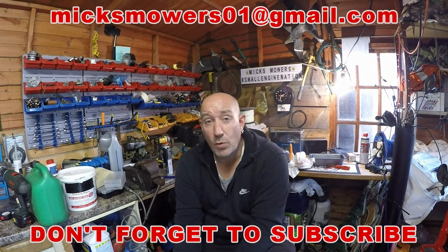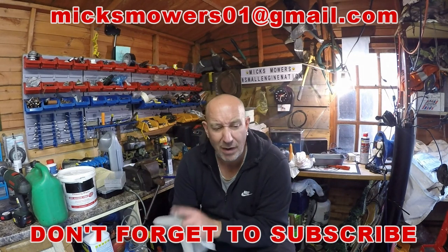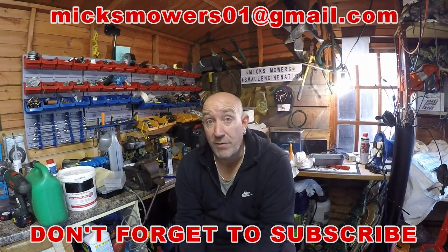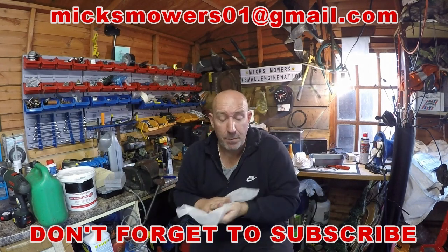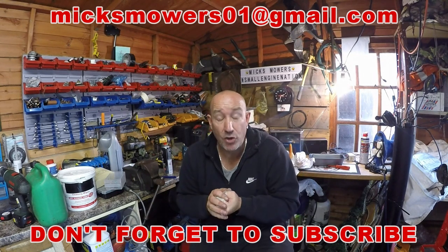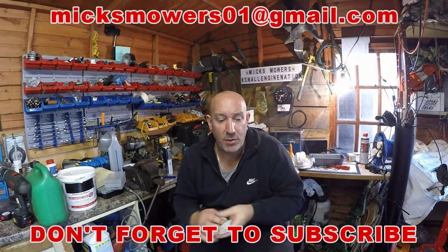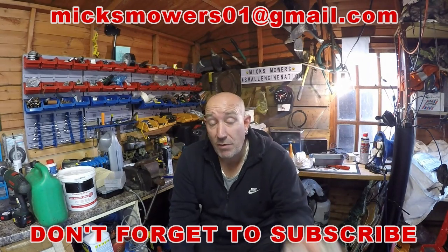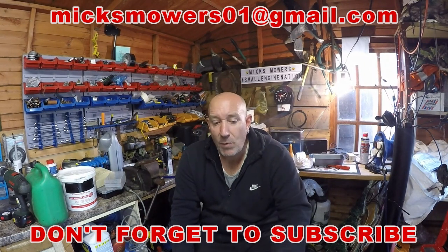So next I've got to do a Power Force Strimmer, or I've got a Homelite Mighty chainsaw. The chainsaw I think I have actually had running already, but I think there's a problem with the brake. I think the Power Force I've not had running, not even tried it, so it could be a runner, it could be no good, no idea. But all in all, for what I paid for the machines already, I should get a good return probably next season now. But what I should end up doing with all of these machines that I'm running, I shall winterize them, drain all the fuel out, get them running, prime the bulbs until all the fuel comes out of them, and then stack them away ready for next year.